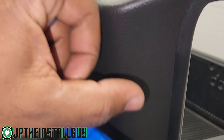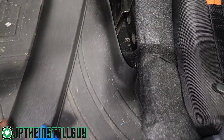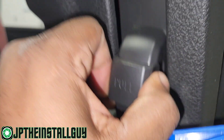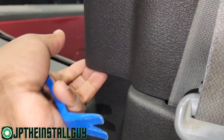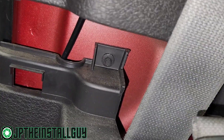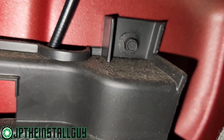The back is not hard. What you have to do first on the left side is take your panel removal tool, come at the top, and pop that small skinny trim off because it's going to relieve one six millimeter bolt right here. Take it and pull it up as high as you can, pop that off. We want to pop all the clips, but we don't actually have to take it off — we can literally just slide it up. When we slide it up, we're going to relieve one more six millimeter bolt right there.